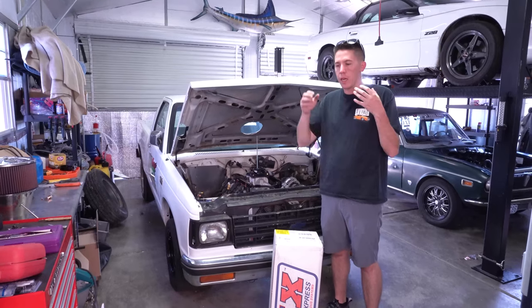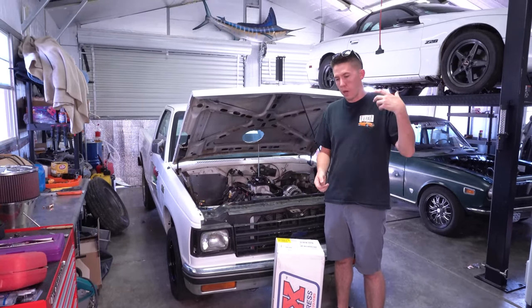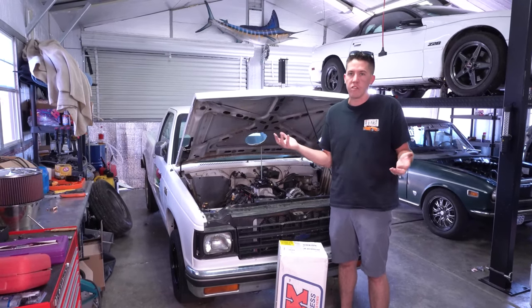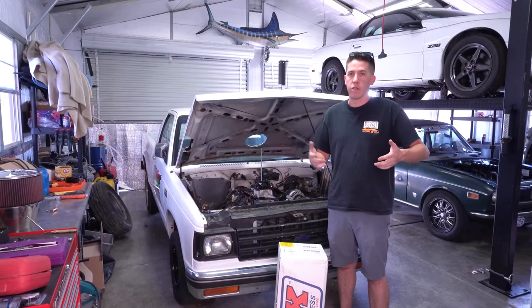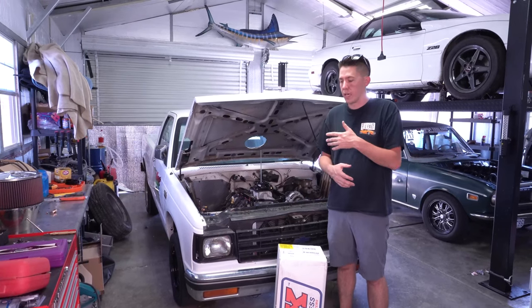We'll find out, but I'm gonna play with that, get that installed, play with the tuning on it, and then my plan is kind of to set up some safeties, but then have it on a button. So whenever I go to shift and it wants to bog, grab the button, try to get it past that. Maybe it's underpowered and it needs that all the way through, but maybe if I just get it past the converter and it can rev to 5,600, 7,500 RPM, it'll be good and clear through that tight spot.